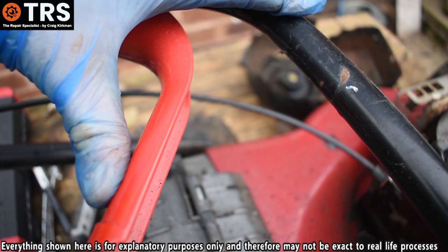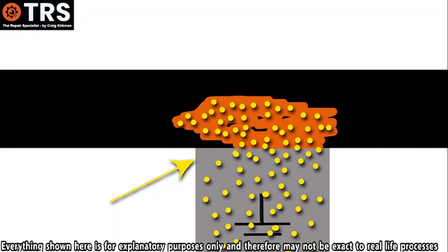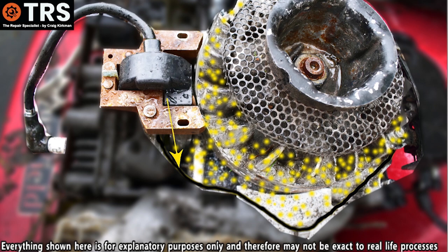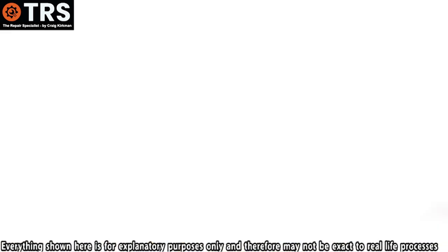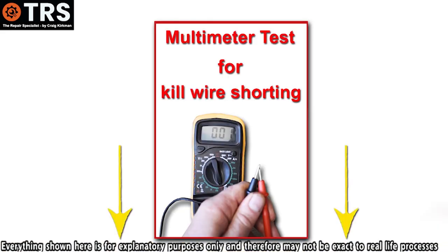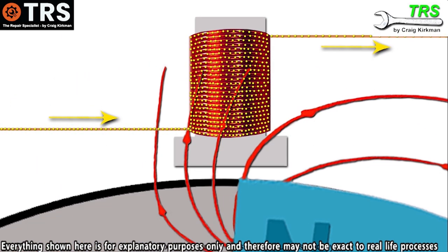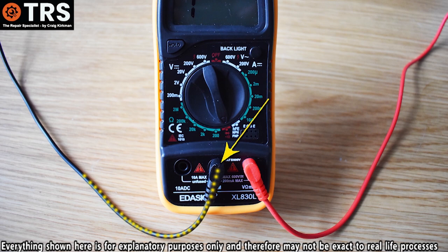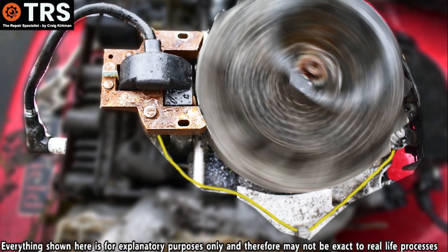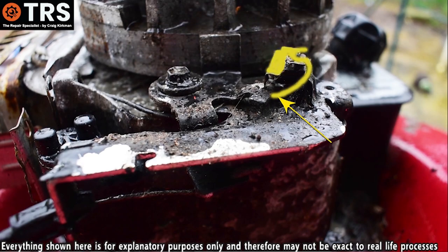In a nutshell, if the OPC lever is pressed and we do this test and the buzzer activates, it's likely that we do have a short in the stop system, predominantly in the stop wire. I've put together a free printable leaflet available on my website via the link in the description below, which will show you how to do this step by step. I know it's taken a while to get to this point, but the whole essence of this video is to give you a deeper understanding of why these things are happening. I really appreciate you watching through to the end — if you have any comments please do leave them below, and I'll be back soon. Thank you for watching.